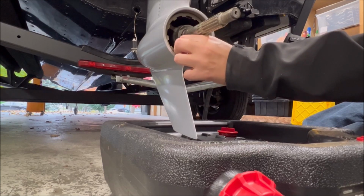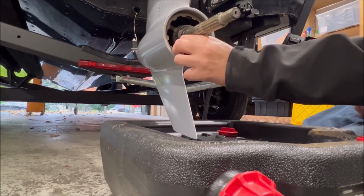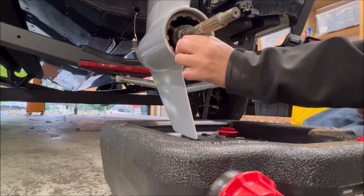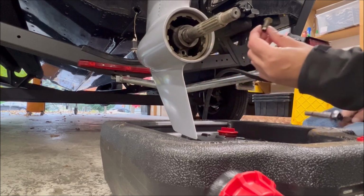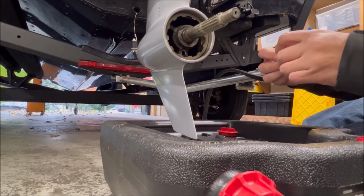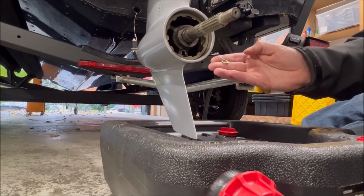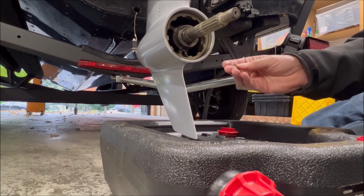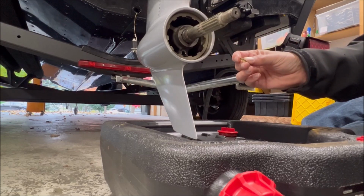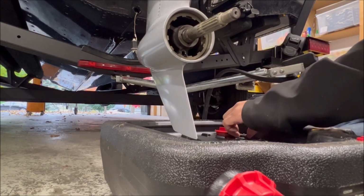Now when you take this out, be really careful because there's a small yellow gasket. I'll show that. That's going to come off with this, or it may be stuck. We'll see what happens here. And you'll either need to replace or reuse that. You see it there, it's stuck to the bottom of this. That's okay. Looks like that. And there's varying opinions. Some will say it's cheap insurance, replace it every time, they're not that expensive, and this is true. Some people say, you know what, I can get a couple seasons out of this and it's in perfectly good shape, and there's nothing wrong with it. So it'll depend what you want to do for your particular boat. I've done it both ways. I'm going to put that off to the side.